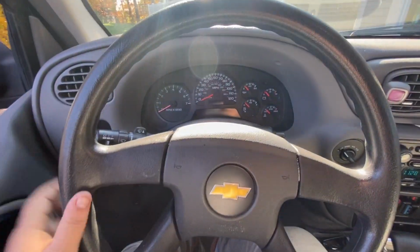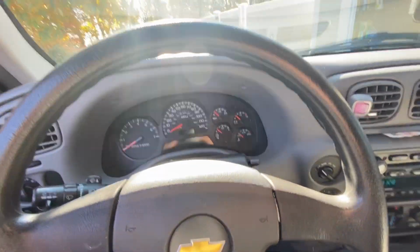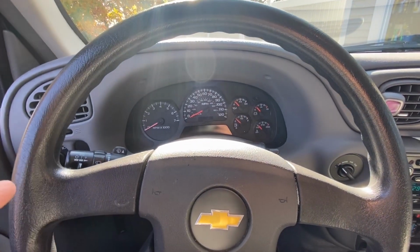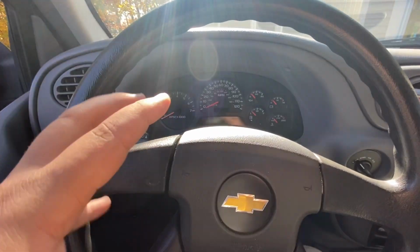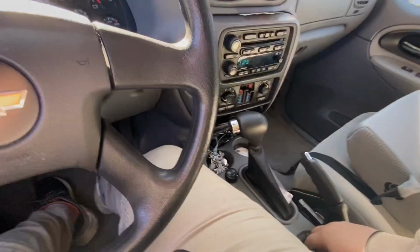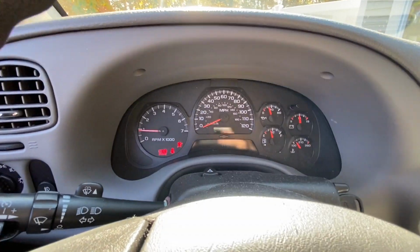All right, so we're back in the car. I didn't film it, but if you guys are looking for this video, you're probably experiencing the same thing. Basically, a telltale of a bad ABS wheel speed sensor is that, like, if you're cruising at really slow speeds or you're slowing down and you go press on the brakes, you'll hear like a buzzing sound, and I don't know, your ABS starts acting all funky and stuff like that. So we shouldn't have any ABS lights on our dash. No brake lights, anything like that.